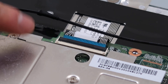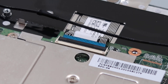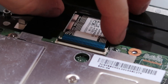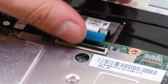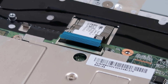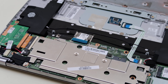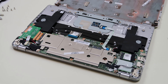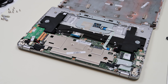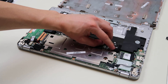There's a plastic flap here that snaps down to secure and folds up to release. So we're going to take a little plastic pry tool, pop that up, slide the ribbon cable out, and then put that back down to keep it safe. Those things are very breakable — you're probably never going to be able to find a replacement if you break it, and even if you do, most likely you'll break it when you're installing it. So really try not to break those things. There's another one similar right there — that's to your touchpad. Pull that ribbon cable out.